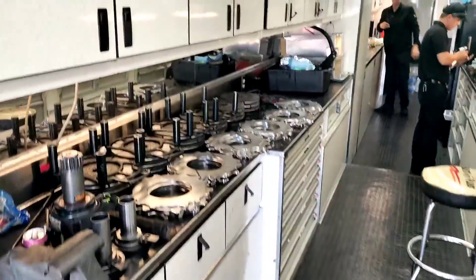The clutch department is ready to go for the rest of the weekend. Bibster asked: on a good run, what's used and what's tossed? Most of the time on a good run, we'll still toss all of the upper rod bearings and all the lower main bearings — we only let them run one lap. We'll push all the rack out and it'll all get inspected and torn down. He'll check all the tolerances and see how much the rod's crushed. Rings — sometimes we'll get a second pass out of a set of rings, but a lot of times they only go down the track once. The heads will still come off and get inspected, all the valves will come out, all the springs will get checked, but a lot of that stuff will live to see another pass.